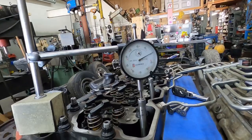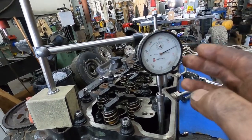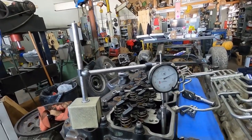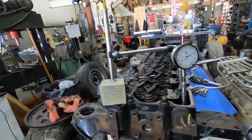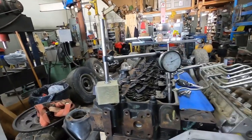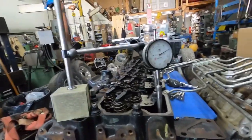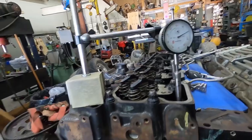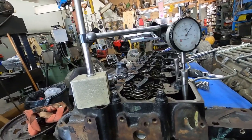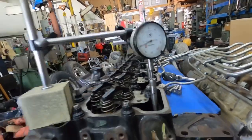It's hard to watch everything at once, but you zero it there. This isn't the perfect way to do it - if I'm building a race engine we do it with the cylinder head off, and I do have a setup for that, but with the cylinder head on it's not long enough to reach down inside. Now that we're at the very highest point on the camshaft, that's where we zero off. Then we turn the engine counter-clockwise to bring it down off that point.